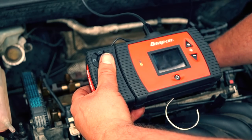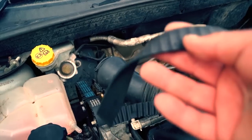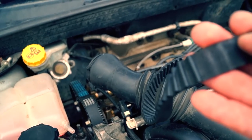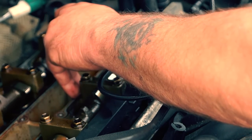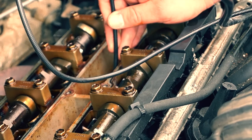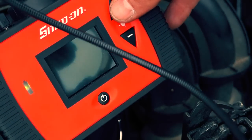I'm looking into a ZTEC engine that's had a little bit of an issue with the timing belt. In fact the belt has slipped and taken the teeth with it. It's suspected because it won't start and it's losing compression - we think that the valves have been bent. So what I'm doing is looking down into the bores to see if there's any damage.